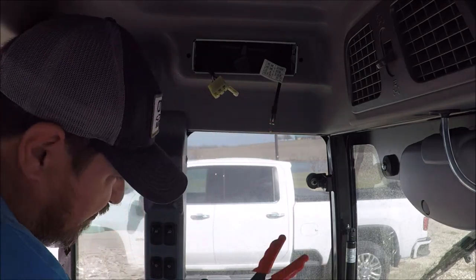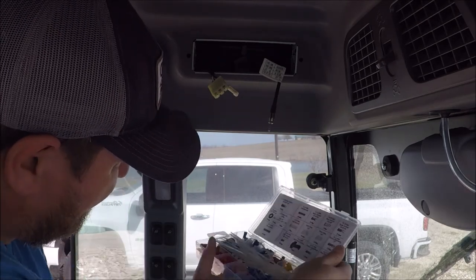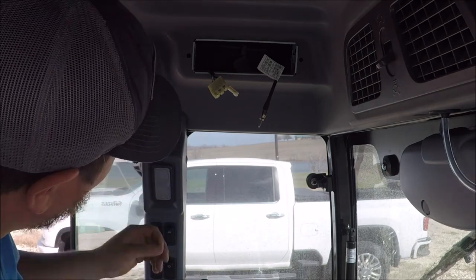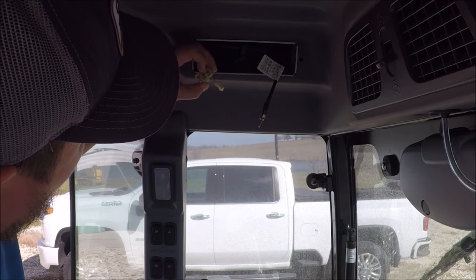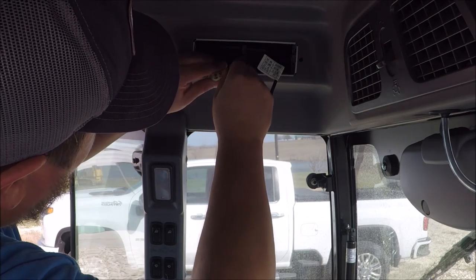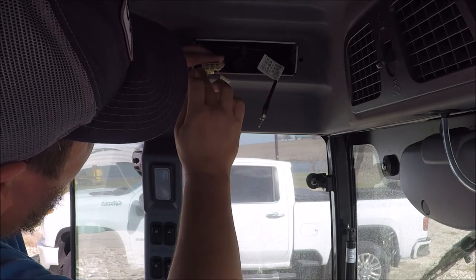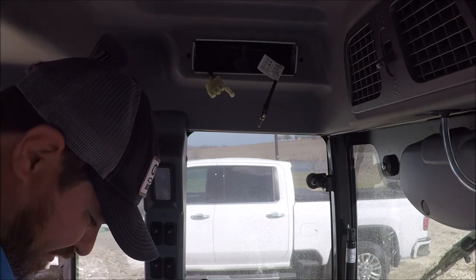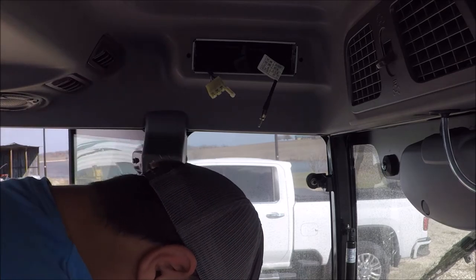Based on what wires I'm going to use, you can pick up one of these cheap wire cutters and crimpers, and here's a little wiring set with all of these connector ends — that's what I'm basically going to be putting on the back of this. Because if you look at it, these are the female ends, and I'm just going to crimp on some male ends that fit in here. This male end is going to slide right into that female end just like it would if it was the original connector. So I'm going to put six of these ends on the right speaker wires, and then see if I have a male end for the little power connector — if not, I may just cut and splice into that one.